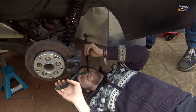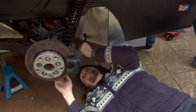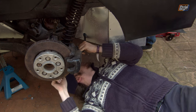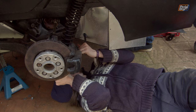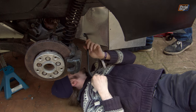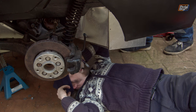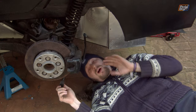Attempting to route the ARB through, it keeps hitting the bottom of the trailing arm because it can't rotate around enough. We try going the other way but there's nowhere near enough clearance. So it's a lower-it-in-from-inside job, but even then it won't go through. The conclusion is we just need to enlarge the holes a little bit - it doesn't need much. Apart from that, this is mostly good - unfortunately we now have a problem with our coilovers.